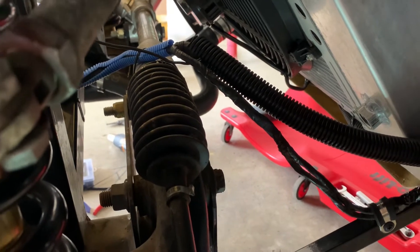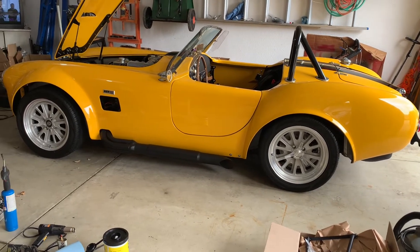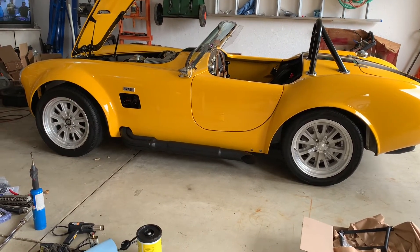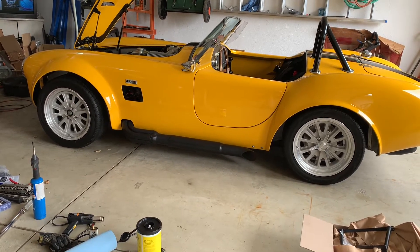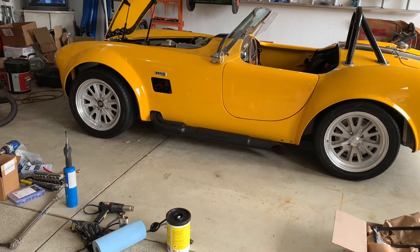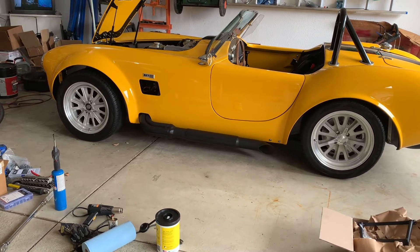Just gonna check the measurement on the coilovers and then I can get the front wheels on. And there is a beautiful sight — she is back on the ground! As far as the front end goes, I set the coilovers with about an inch and three-quarters of thread below the adjustable perch; that's where the driver's side was. The passenger side was completely wound down. The car hasn't settled yet, so I'll drive it and see where it sits — it does look a little high in the front right now. I'm gonna go ahead and put air in the tires, make sure everything is where it's supposed to be, and get this thing fired up and set the timing.